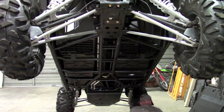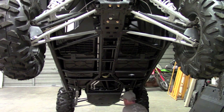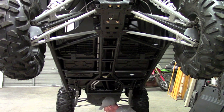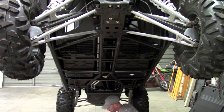Okay, now that that plate's hung, we can go ahead and start the other hardware. This rear plate takes four clamps. They are all marked the B clamp. And then you have your bolts, the heavy duty washer, and then the bushing on here. The bushing is just to prevent you from over tightening and actually pulling the bolt through the UHMW, through the plastic. It will compress.